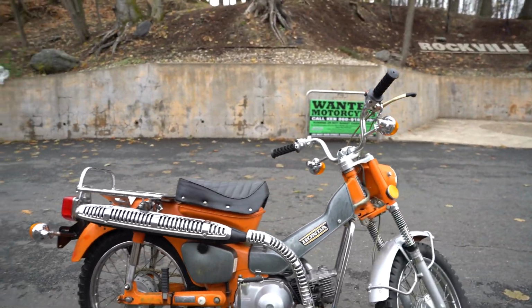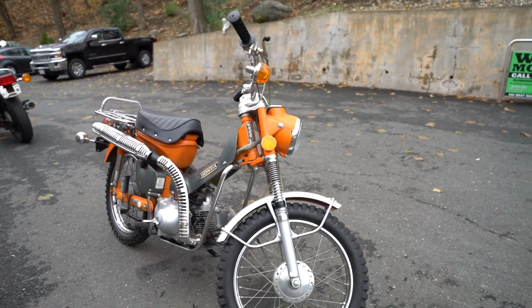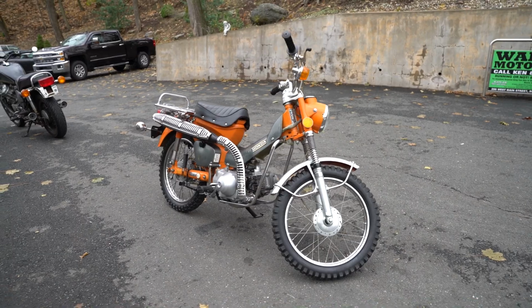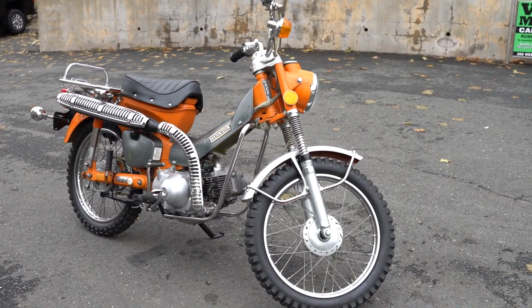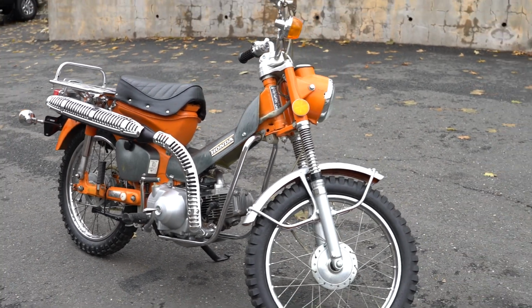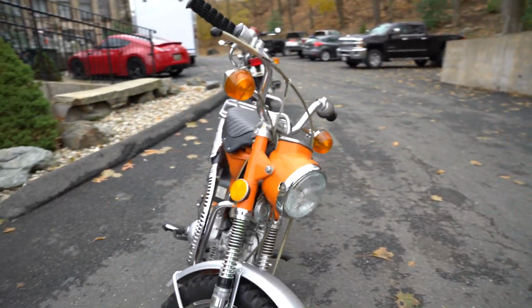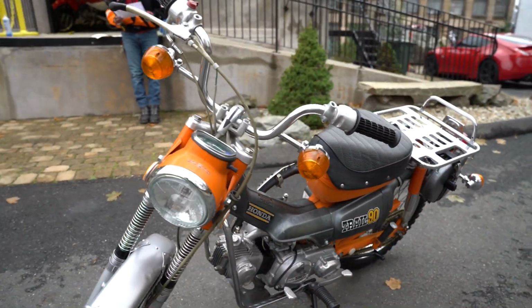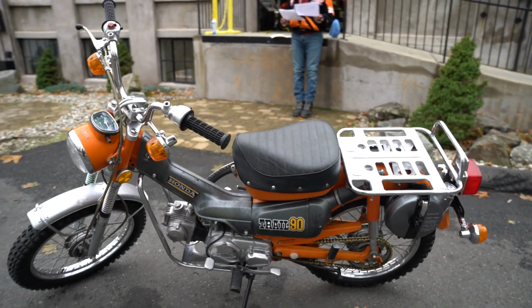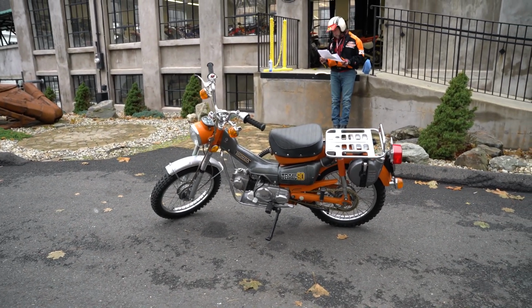Did a nut and bolt safety check. Jimmy Laurinaitis actually worked on this one. As far as the parts go, the thing was in pretty damn good shape when it came in, so we didn't need a lot of parts, just the battery. If you zoom in, you'll see it's a brand new NOS Honda headlight on it. Not a China knockoff. We put a new chain on it, a gold 420 chain and the Maxima 10 weight 40 oil. Then it went to the detail shop, got a steam clean, pressure wash, hand wash.